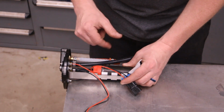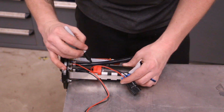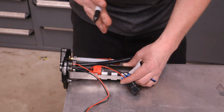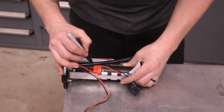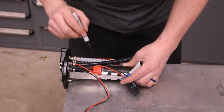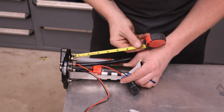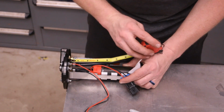So this line goes onto the cap for the pump. So I'm gonna mark this here, and you can adjust it. I'm gonna cut it about 1/8 of an inch short so that I have a little bit of playroom in case I need to go up higher. But you can't put it back on, so don't cut off too much. So we're gonna cut each of those at this point, which on our particular tank, if I measure from here to here, is right at about 2.5 inches.